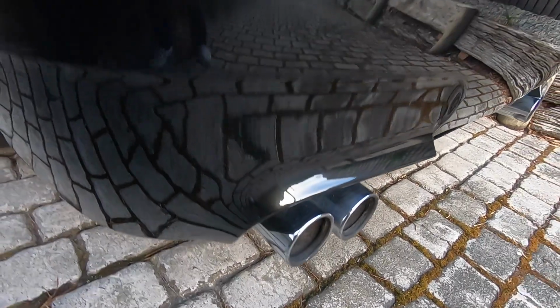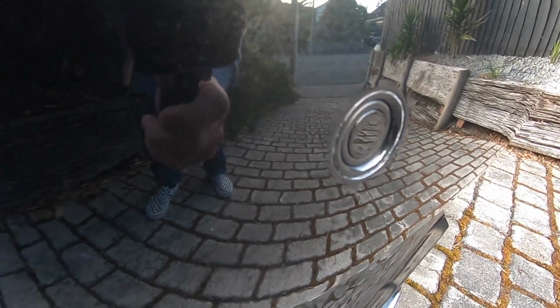Now it is pretty tight, but you can just about gain access to the parking sensor there from the back, but you'll have to unclip it from the bumper and disconnect the electrical connector at the rear there. Now it is doable, but there isn't much room around the back there, and to be honest with you, even when them electrical connectors are staring you in the face, they can be a bit tricky to disconnect, so trying to do it all one-handed and blind with no room from the rear there could turn out to be a bit of a pain.